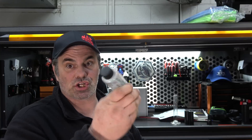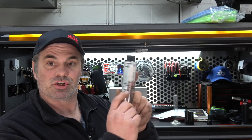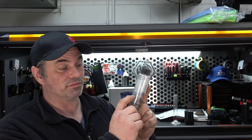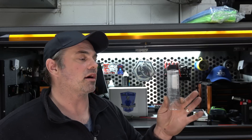You fill it up the rest of the way, give it a shake, and let it sit. When it finishes settling out, it'll show you your alcohol content, and the more it rises or separates tells you how much water is in there. Really important PSA — if you're doing diagnostics, it's something to look for. You've got to start testing for it.